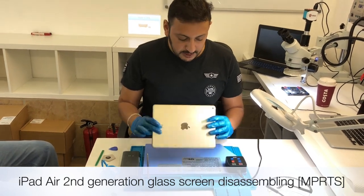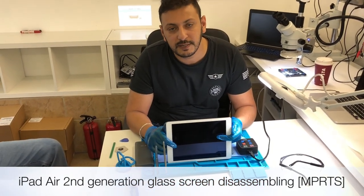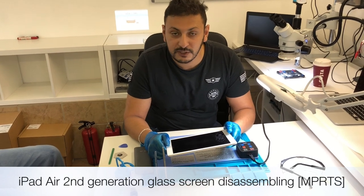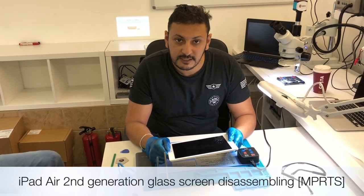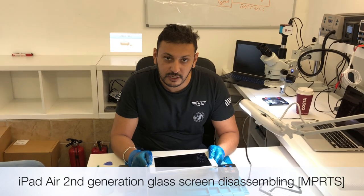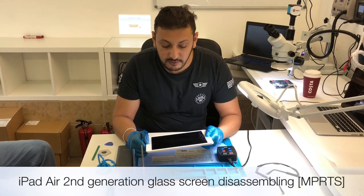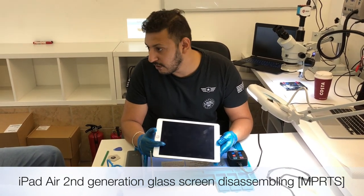Try again to make sure the device is off - this is a common problem. We get a lot of devices from other repair centers where they open the device and start taking off cables without disconnecting the battery. The battery is at the bottom and the motherboard sits on top, so power is always in the circuit. Playing around with connectors can create a short circuit, and a common problem is called backlight coil - you'll see no screen or no light. Always disconnect the battery, hold the on/off button for a few seconds to drain power from the motherboard before working.